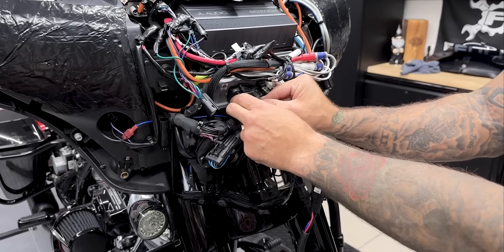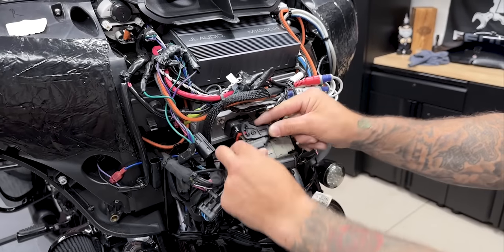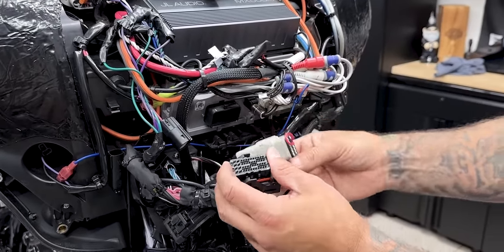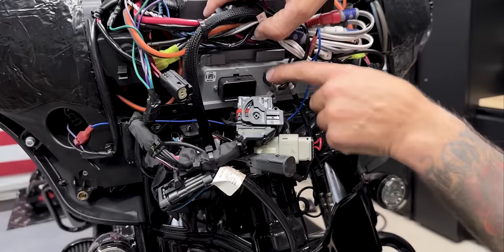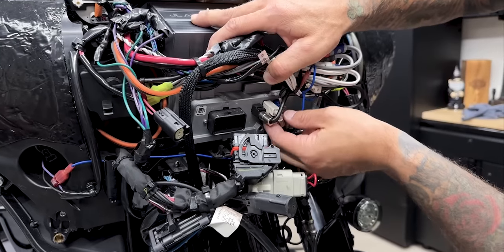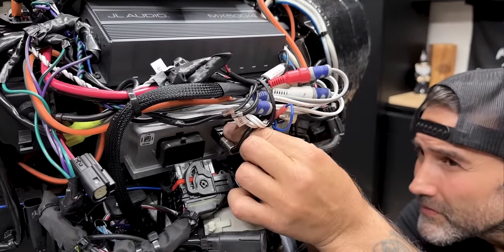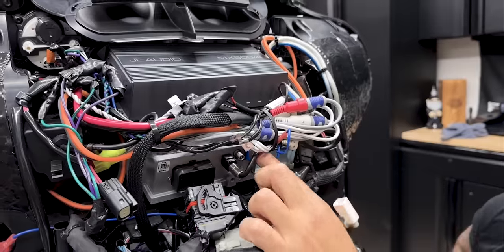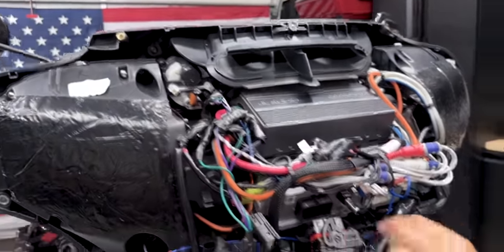Here you have a tab for this big connector — this is your main harness, your stereo — just pull that off. These are different connectors for your Whim, and you have your jumper for Apple CarPlay. If you had rear speakers for a tour pack, you can connect them right here. Here you have your USB cable — you don't need to disconnect this one, it just goes to your media compartment. Take this connector out — this is your AM/FM, leading back towards your antenna. The tab is usually on the bottom and it's easier to push it in with a screwdriver. You can also leave your GPS since it's located right up here.